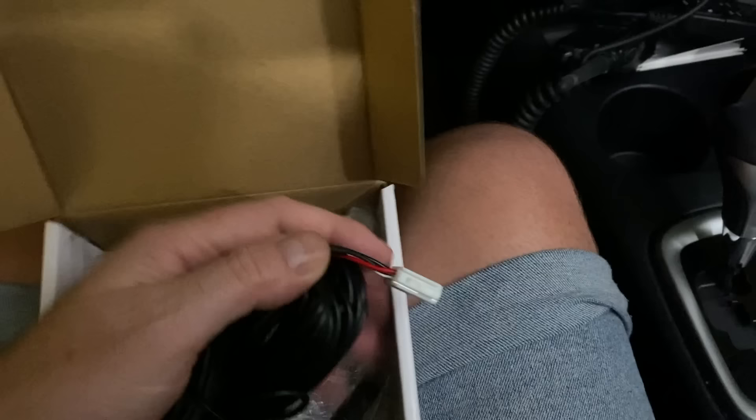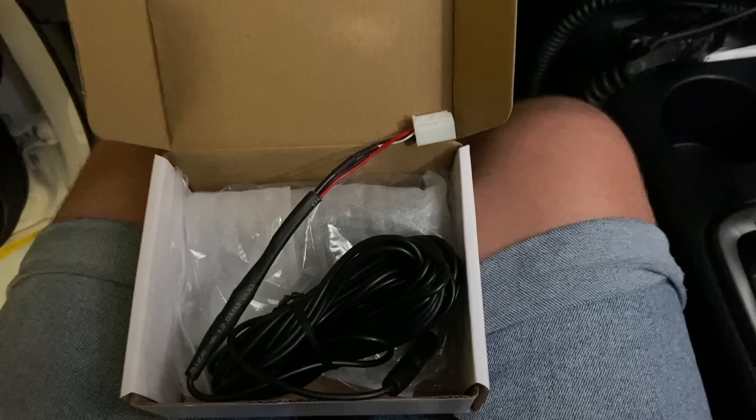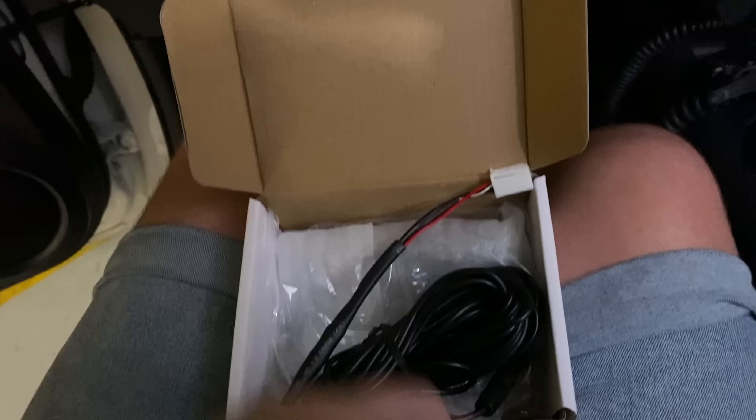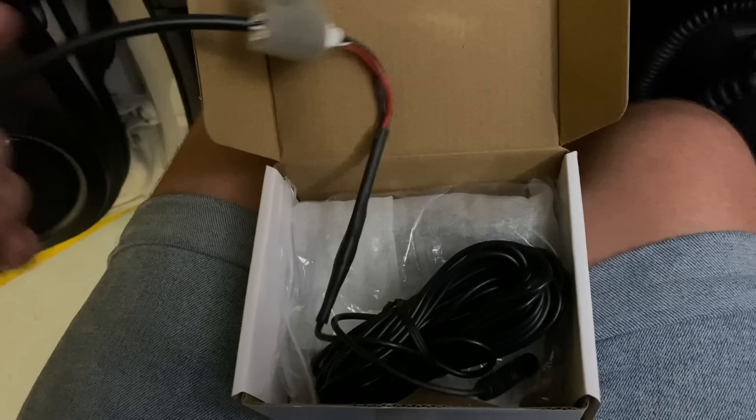We're going to be using this Soundskin Visions camera, which we custom make to suit the Toyota Hilux. We put a genuine plug on here so it's all plug and play. This is easier than the earlier model kits we do for the Hilux — we sell camera kits for all Toyota Hilux models from 2006 right through. Previously you had to pull the stereo out, but not on this one. This is our patch interface harness with the four-pin plug, and you can just plug it straight in — it literally clips in one-handed.